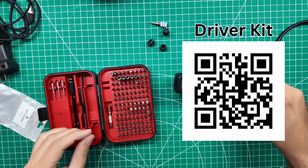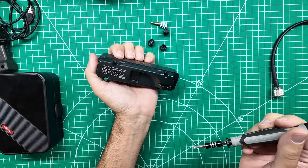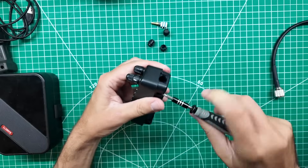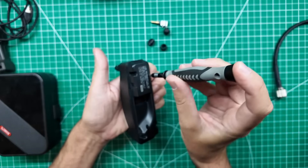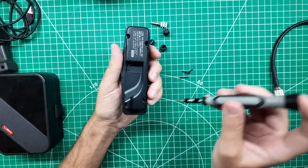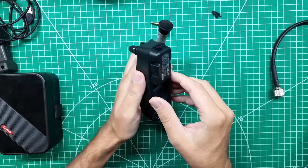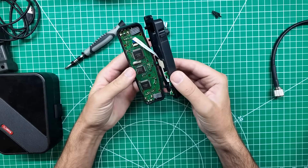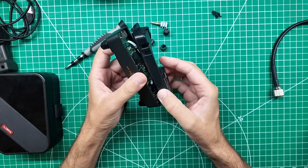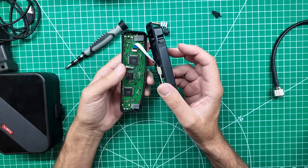What are we looking at here? We're looking at Phillips — those are probably number ones. Do not install in front of a heater vent or expose to direct sunlight. I don't see anything that says don't open this up — warranty void if opened wouldn't matter anyway, this thing's so far out of warranty. Long screw on the bottom, same size screw on top. All four screws are the same size — perfect. There's a ribbon cable that goes to the microphone connector board, so be careful when you're opening this up. I let the tension go immediately so I didn't damage the ribbon cable.